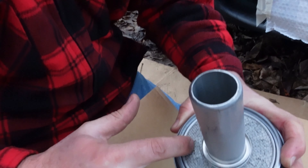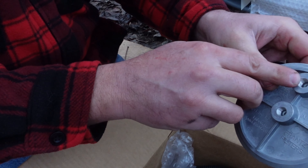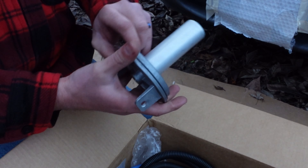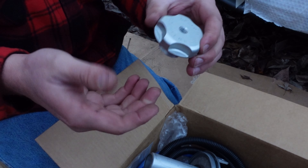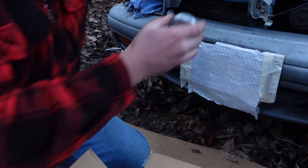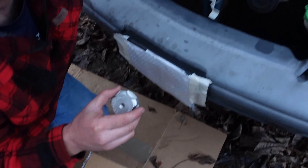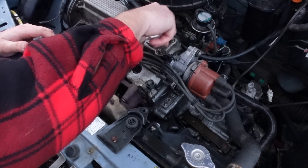And then across this screen — there are some valleys in there that all lead to this outlet port. And then from there it goes through a hose. There are multiple ways to do it, but the easiest way is to just run it back into your oil filler cap. And luckily this one fits right on my car.